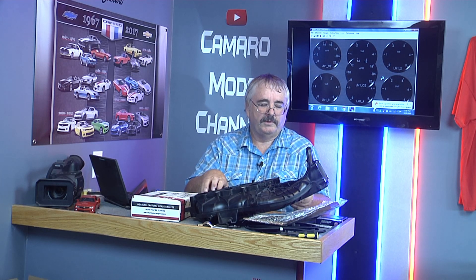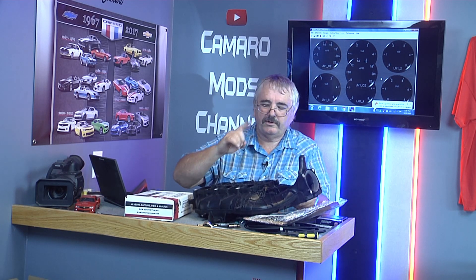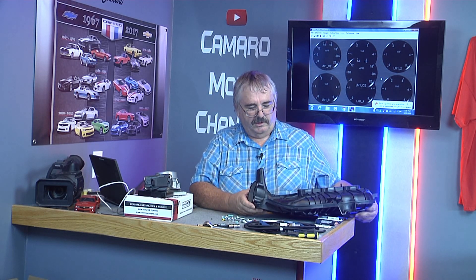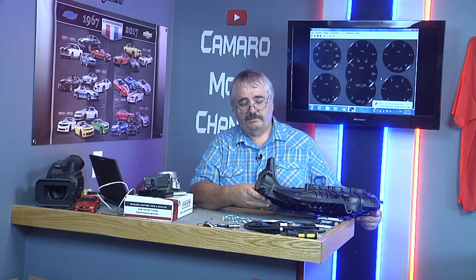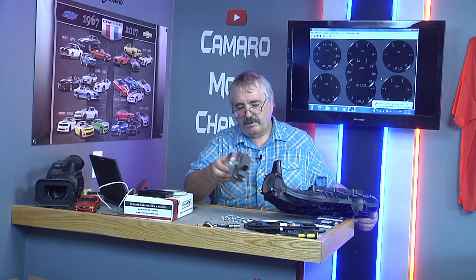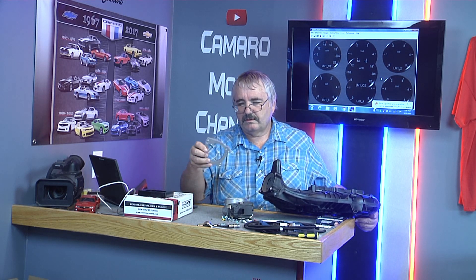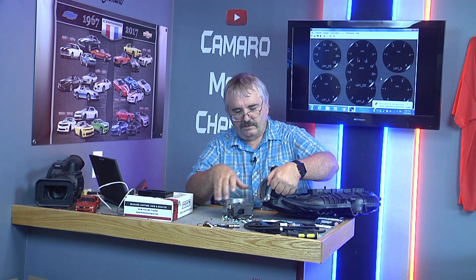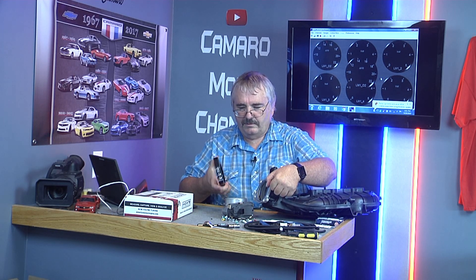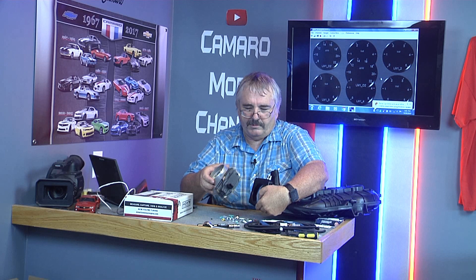Because I want to try the big 80 millimeter throttle body. We got the plate that goes on here — this is $450, with an extra $50 to port it out for the 80 millimeter throttle body. See, that doesn't come close to lining up your bolt holes, so you've got to have this adapter ring here and it'll go on there like that. And then you got your nitrous plate that goes on there, and then the throttle body goes on top of that.